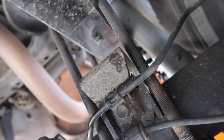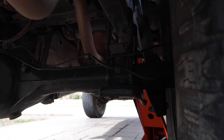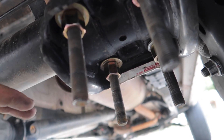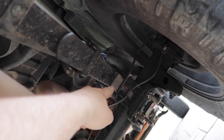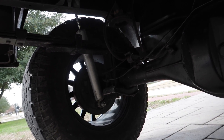You put that side facing down and it's going to fall right inside of the hole on your frame. Make sure that's in there good and tight. Then this nipple right here is going to go inside of that nipple hole, and they've got to line up — that's going to be the hardest part. If worse comes to worse, use a ratchet strap on the axle and tie it to the receiver hitch to pull it back, because usually when you lower it down the wheel will fall forward. So pull the axle back a little bit and it should fall right into place. I'm using these studs for the U-bolts — they're strong, reinforced, and brand new. I'm going to cut these right about here so I can get a deep socket on there. I cut those bolts off — they're hot. Got those tightened back up. There is now a Z71 lift kit for a Chevy on my Tacoma. Now I just got to do the other side, then the truck will be sitting right.